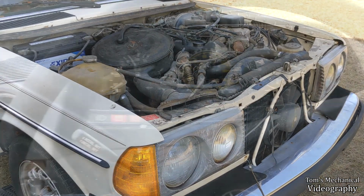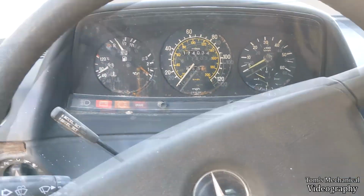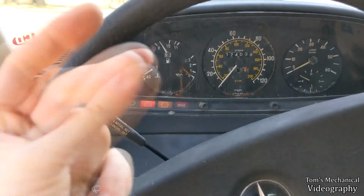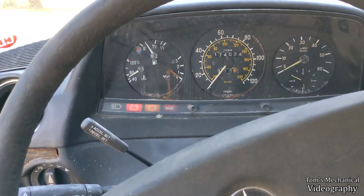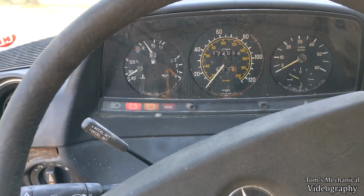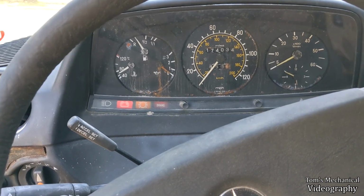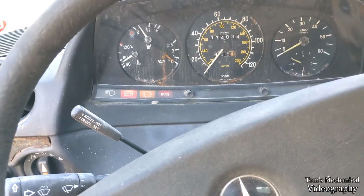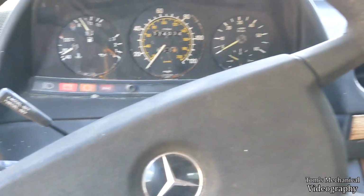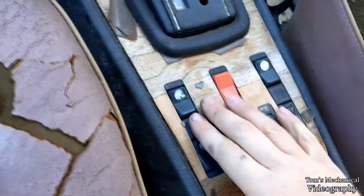I think. Well, I'm just in here, playing around. I've got the key in the on position. I just tried to start it up, and it started up instantly, so it's just a temperature problem with this thing, so I'm assuming the glow plugs are either totally burnt out, or there's just so much carbon on them that they can't do their thing, and that's the main reason why she's not starting. But, anywho, I'm just playing around with all the electronics in here, seeing what works,